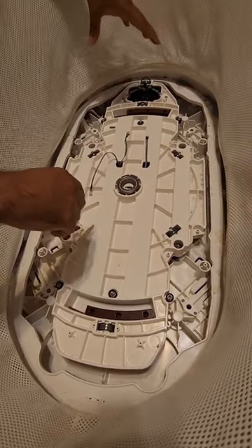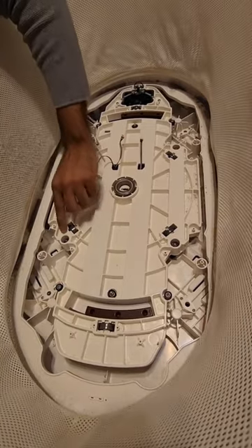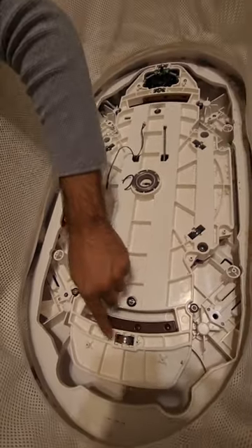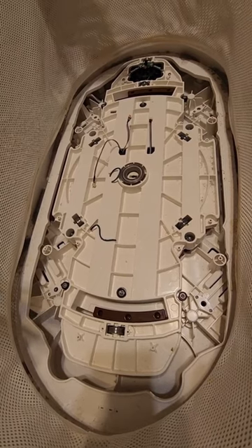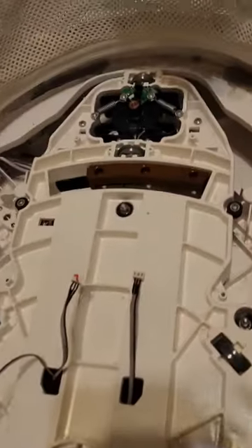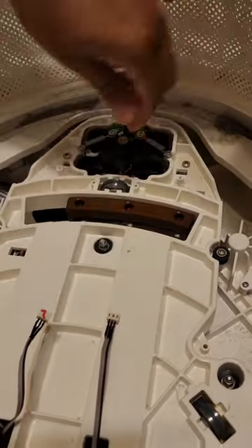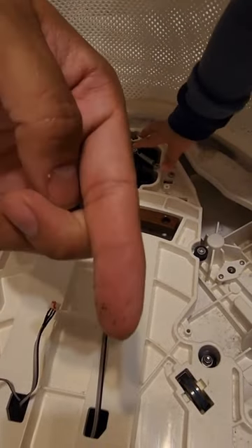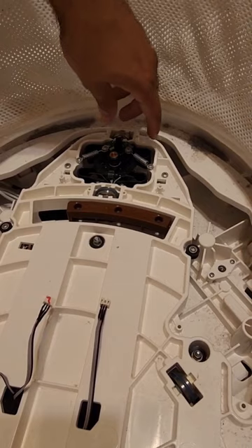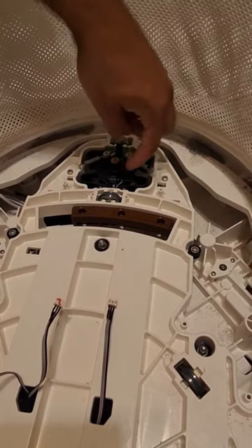At this point we're going to inspect all the o-rings. I received this unit because it's not rocking smoothly. Just by opening it I can already tell this o-ring right here is ripped, this one over here is ripped, and this one is completely missing — so that's clearly the problem. We can also see the motor has a little bit of wear; if I run my finger across it I can see all of this black debris, which tells me there's been a lot of wear on the o-rings of the motor. We're going to go ahead and replace all the o-rings.